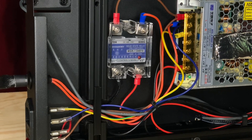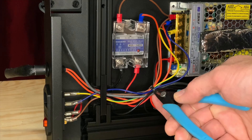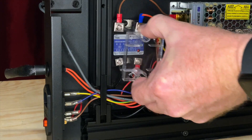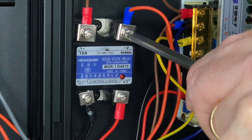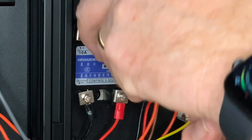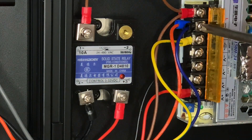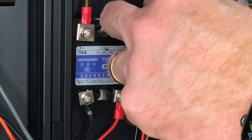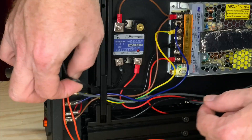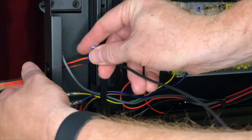Remember earlier when I said you needed to turn the printer off and unplug it? If you skipped the unplugging part, please unplug the printer. You don't want to accidentally become a famous conductor... of electricity. To make things easier, snip the zip tie that's keeping all the cables bundled together. Then remove the clear plastic cover from the solid state relay. Remove the screw securing the red wire on the solid state relay — it's on the output side, labeled as number two. This is one of the two red wires that goes out to the bed heater. Remove the screw securing the bed's other red wire to the power supply, connected to the terminal marked N for neutral. Note that this terminal also has a blue wire coming from the power socket — we'll be putting that back on later. Carefully remove the bed's thermistor wire — it passes through a couple of cutouts in the frame. Then feed the stock bed's wires out through the cable grommet at the back of the printer.